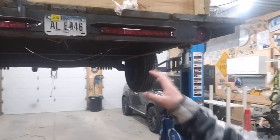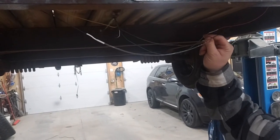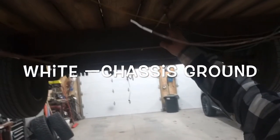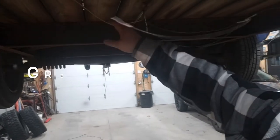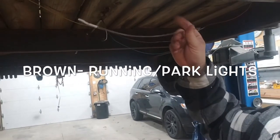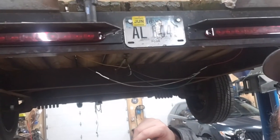Alright, so we got all of our wires and everything wired together. We went in and soldered them together, and also used heat shrink on all the joints to make sure everything's all sealed up tight. The white wire goes to the chassis ground, or ground onto the frame. Yellow is the left-hand side. Green is the turn signal for the other side, and the brown wire is for the running lights, so we should be able to do turn signals, running lights, and brake lights — all that good stuff.